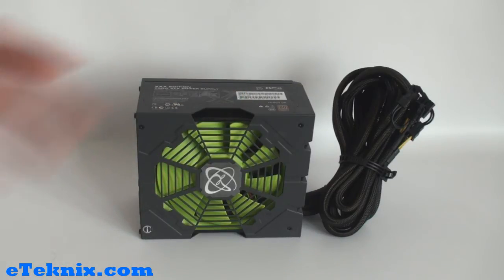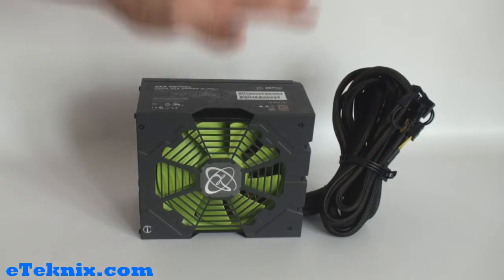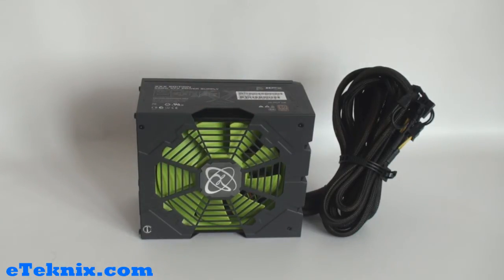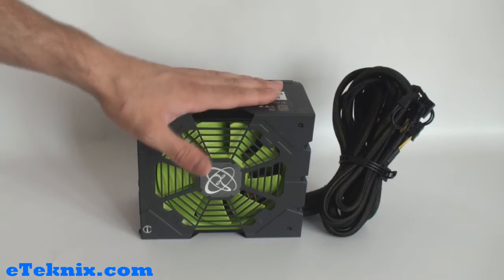The second thing I look out for is the wattage. This is a 650 watt power supply. There are power supplies out there that claim to be a higher wattage but they're not - cheaper ones like Q-Tech, which I've used in the past and they have actually exploded. They rate them at 750 or 800 watt but that isn't a continuous power stream - it is the peak wattage. This 650 watt will power probably the most extreme gaming systems depending on how many graphics cards you're using. As components are developing they're using less power, so you don't need 1200 watts. There are also websites where you can plumb in all the details of your system and it will tell you exactly how many watts you need.